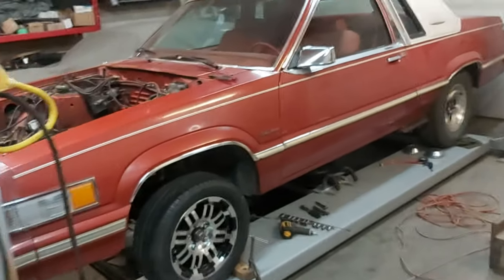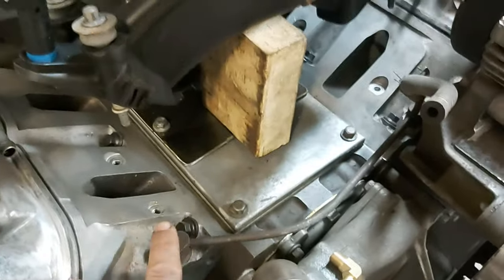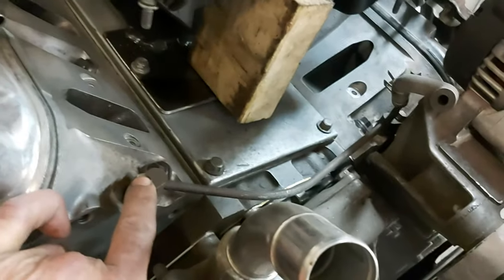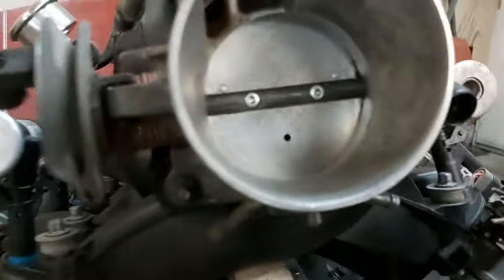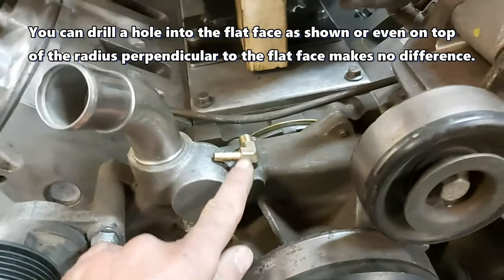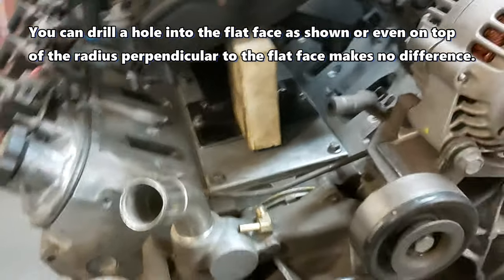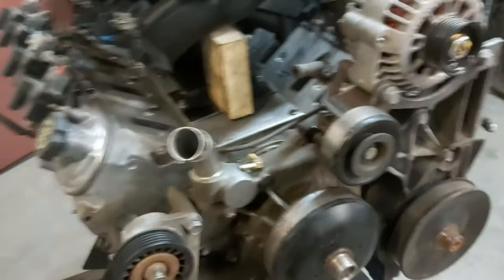So we're in the garage here at Project Turbo LS doing a video on the LS steam lines. This is our 6-liter we're using for the project. As you can see, here's the steam line that goes from head to head — from that head over there to this one over here — and it feeds into our throttle body, comes out, and then goes to our radiator as I showed you on the truck outside. We're eliminating that because we don't need a warm throttle body anymore. We're gonna drill and tap for a 1/8 NPT fitting into the top of the water pump right here, hook the line up to that, and it makes for a nice clean installation without having to hook up to the radiator.